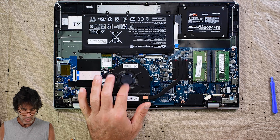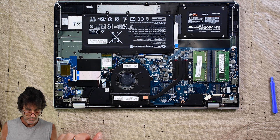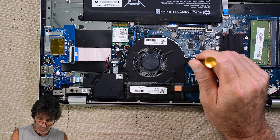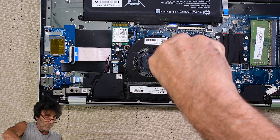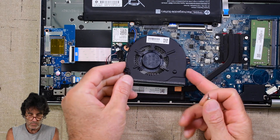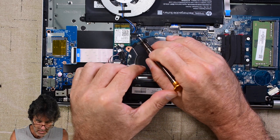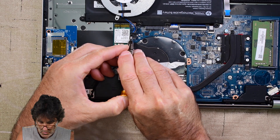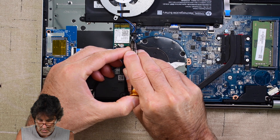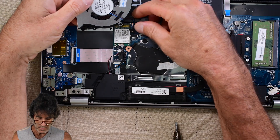Here's our fan that's making all the noise, and the battery is right here. Let's go ahead and pull that fan out — very easy, just remove these screws. Pop it loose, and be careful with the plug. Take a flathead screwdriver and just work it back and forth slowly until it comes out, just like so. Put the new one in the same way.